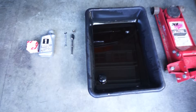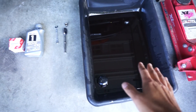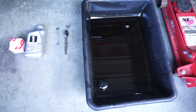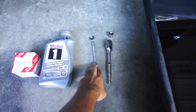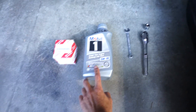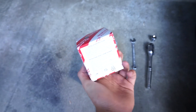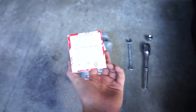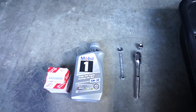What you're gonna need for today is an oil pan — something to put your oil into. You can recycle these at any automotive store like AutoZone. You're gonna want a socket set with a 14 millimeter to get your drain plug off, and a 10 millimeter to get off those plastics. I use 5W30, I use Mobil 1, that's full synthetic. And a Toyota oil filter — Walmart has partnered with Toyota and they're selling these now, so might as well just get the OEM one from Walmart.